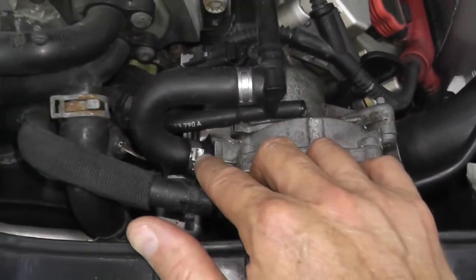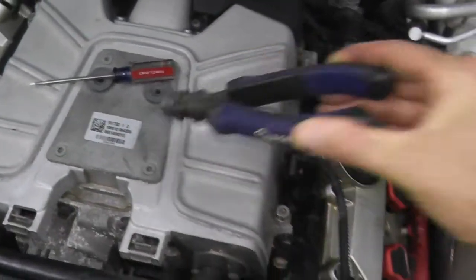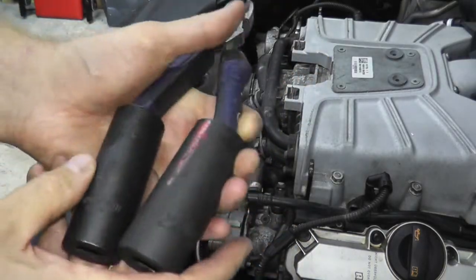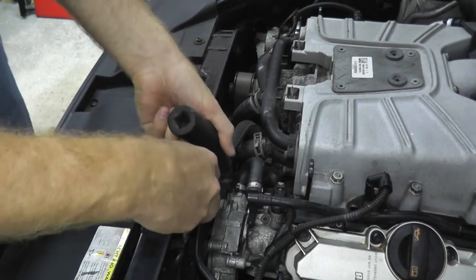You can purchase a tool made specifically for cutting these clamps, but it's pretty expensive. Chances are you have side cutters. To give some extra leverage, use a 21 and 22 millimeter socket, half-inch drive, with a longer handle — you need the extra leverage. These are really really tough to cut.